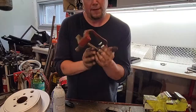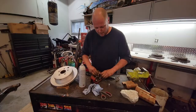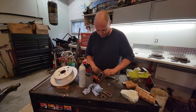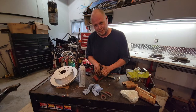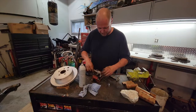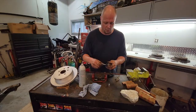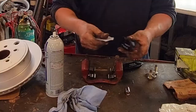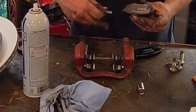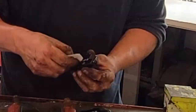That's how I did it with the other one — worked out all right. I could have taken the time to clean these off real nice and powder coat them, but I have to drive the car to work tomorrow. If I'm going to start powder coating brackets I'd like to do the entire caliper, and that would require a rebuild kit which I don't have right now. So we're going to hold off on that. They're in. We can set our brake pads inside. They gave us this little packet of brake lube — we're going to use it. I'm going to put a little bit on the ends where the pad slides inside that bracket and the new clips. This side is facing the car where the piston's going to come out of, so we're putting a little grease where the piston's going to rub on it, to keep it moving freely. Trying not to get any anywhere on your brakes.